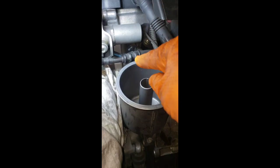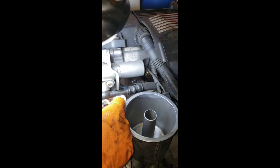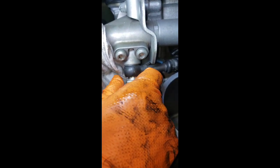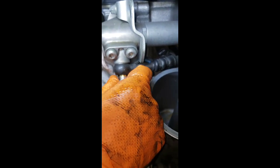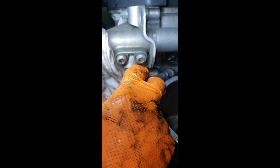Once you remove this, remove the bolt and the filter gasket - it's a 19mm banjo bolt. As you can see, it has two washers: one on the top and one on the other side, so the vanos goes in between the two washers. Put some rags to catch the leftover oil.